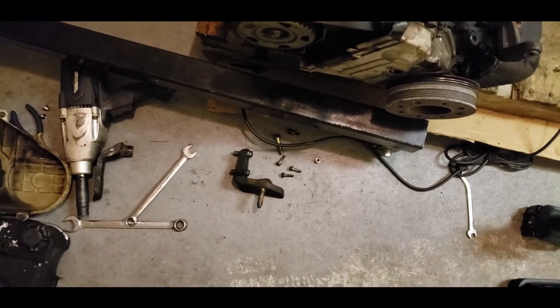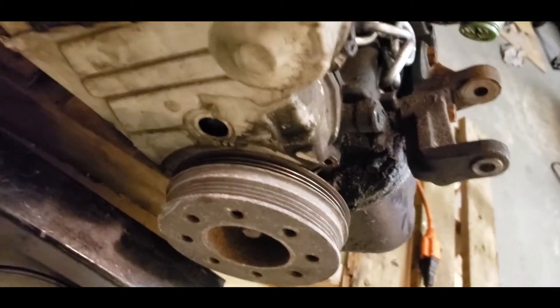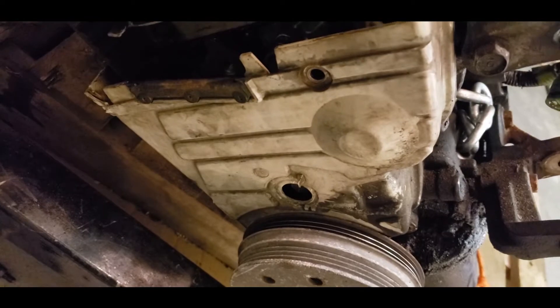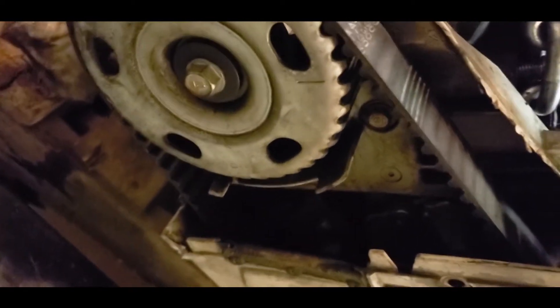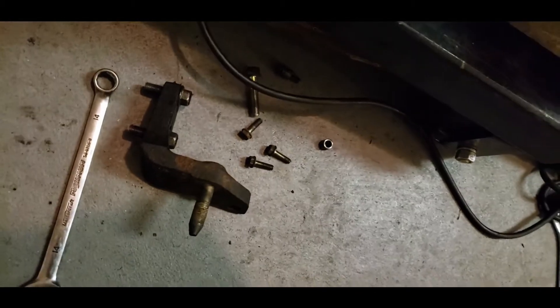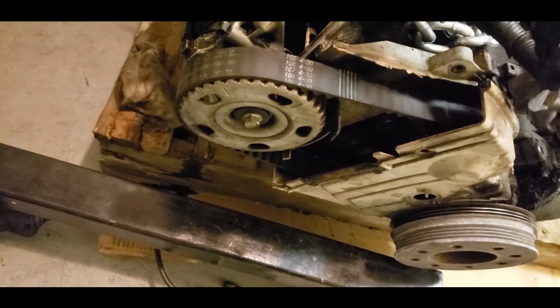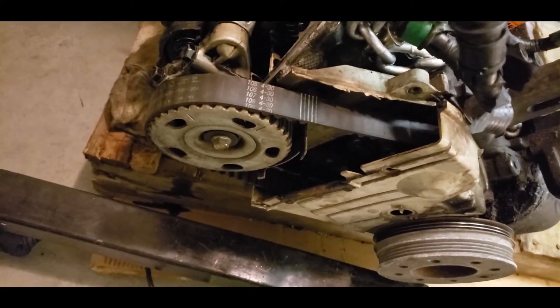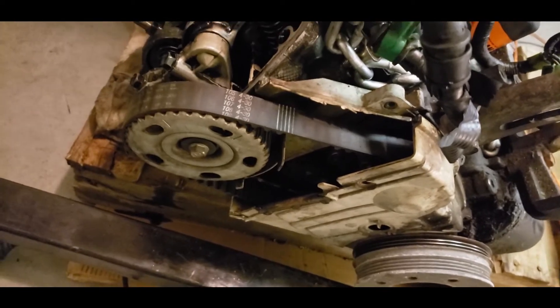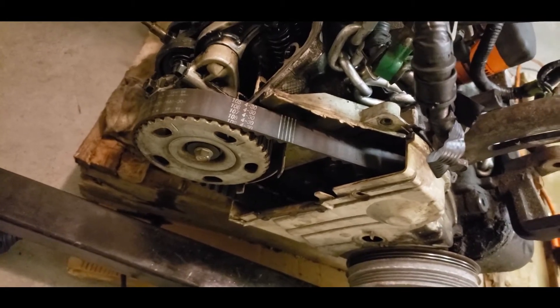I got that bracket off without having to remove the crank. How you do it is you basically loosen up the timing belt cover and then use some wrenches - a 14 and a 17. You use the 17 for leverage and crack it. The bolt will undo once it's loosened and then you just use the wrench to slowly remove both bolts. They do come out, it takes a little bit of time and patience, but it does work.